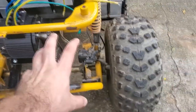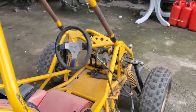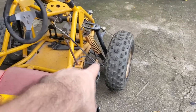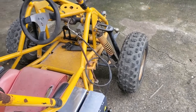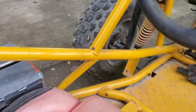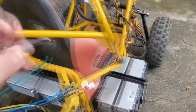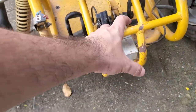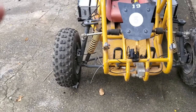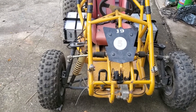Now let's talk about the brakes. We have brakes here and two front brakes, but these will change. I will be using Honda Civic front disc brakes — basically the system here will be like a real car-type brake system instead of these tiny little brakes. You've seen my go-kart video when the brakes failed; I don't want that to happen with this power. So we will have a big brake pump here in the front — a brand new, automotive-grade one. No vacuum pump — it may be unnecessary, but I will have to test it out and make sure.